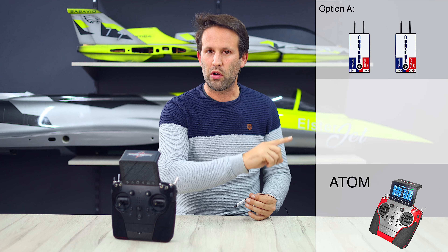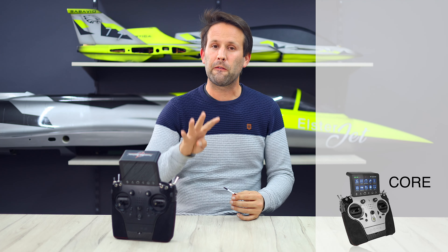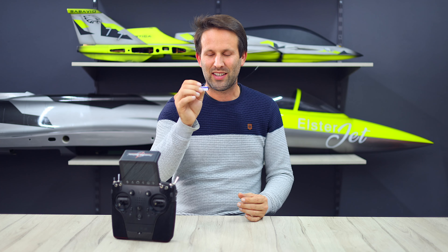You can even still hook up an iGyro SAT, just like before. All you need is a Y-lead — connect both the SAT and the 26XS into your receiver's fast track port. You can even still use a GPS to control your gyro gain, simply adding in an extra Y-lead or using the hub. The setup I'm going to go with when building the FC-1 jet behind me is likely going to be two PBR26Ds in the fuselage going into the Powerbox, with one attached to one of these 26XSs all the way in the tail for added peace of mind. In this case the iGyro SAT will be connected directly into the Powerbox — specifically the Mercury SR2.